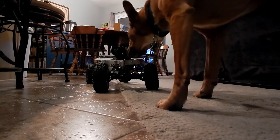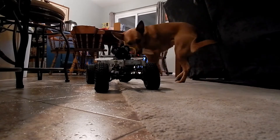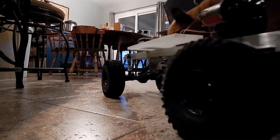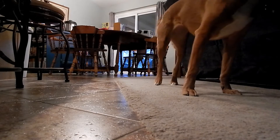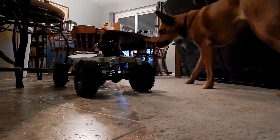The 45-turn motor going through the Traxxas transmission to the HBI has its maximum speed at about my walking speed, which is kind of where I want it. After I get the second motor in the truck and running two batteries, it should have plenty of full-on power.